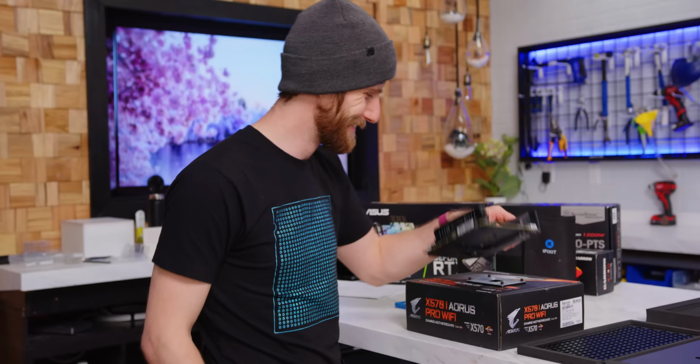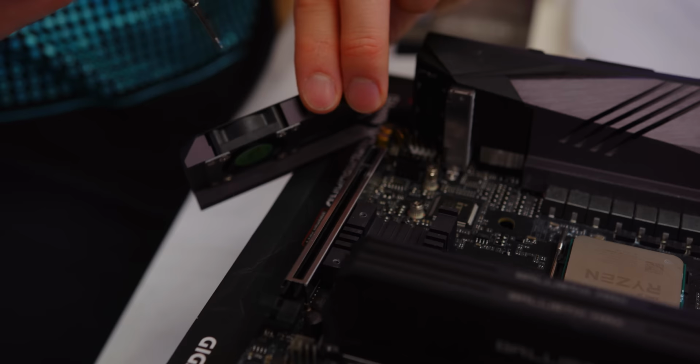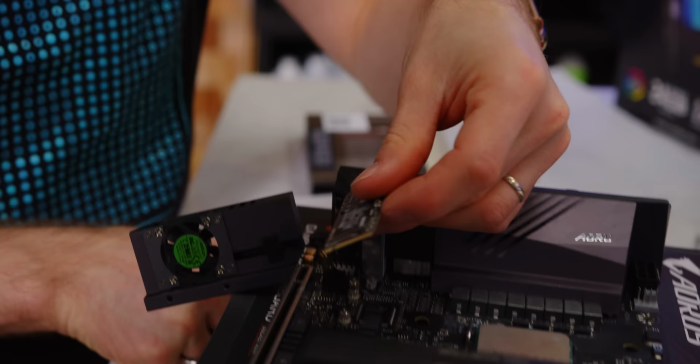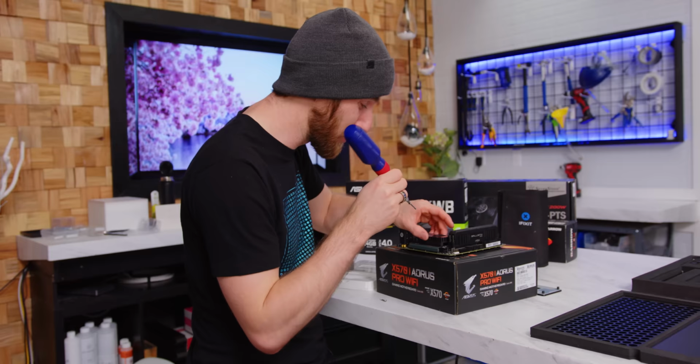More megahertz! And continuing that theme, we've gone with the fastest storage money can buy with the 2 terabyte Samsung 980 Pro SSD. This will be running at full PCI Express Gen 4 speed, and as you guys can see, even though there's no chonky heatsink on it, it has a fan for active cooling, so I would be very surprised if we experienced any kind of thermal throttling.